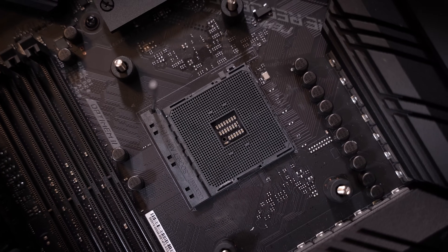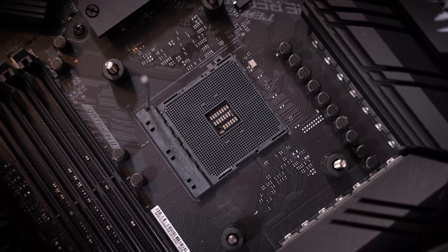The socket physically itself does not seem to be the issue here. At this point you've just got to ask yourself which you would rather lose in a worst case scenario — the motherboard or the CPU — because we can't really tell which one is to blame. Even if we had a Dr. Debug LED saying code 00, I've gotten code 00 when the CPU was bad and when the motherboard was bad. We've ruled out the other major components and it's not a wiring issue — I checked that off camera. He's got all of his connections on his power supply; it's a modular unit. Also checked that the smaller connections are removed from the equation when trying to power the rig on.